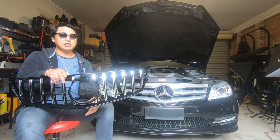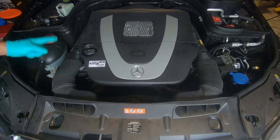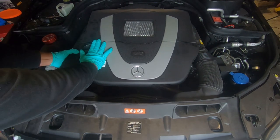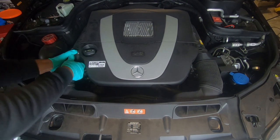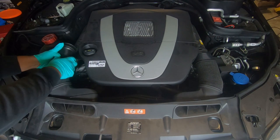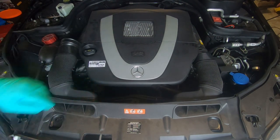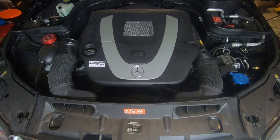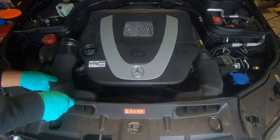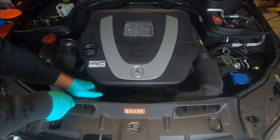Without further ado, let's jump straight into removing the front grille, updating it and refitting it. First, let's remove your air filter duct. To remove these, all you have to do is pull back on them until they come past this clip here. You have a clip here which you will need a flathead screwdriver — in my case all I use is a trim removal tool. You'll see a clip up here, push down on it, and then you bend it down and pull out.